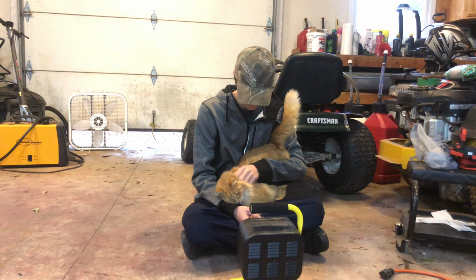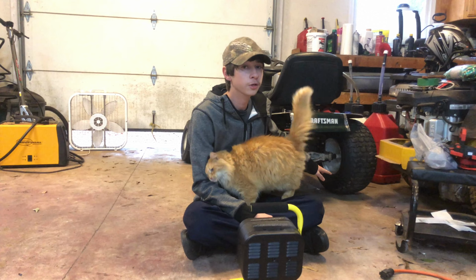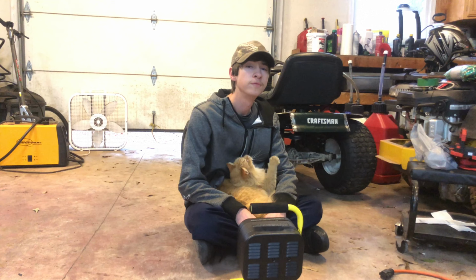So I did the math, and turning 4,000 RPMs, because that's a 1 to 2.5 ratio to the rear end, it's going 53 miles an hour in sixth gear. Cars and Cameras went 42 miles an hour. We're gonna do better, and we're gonna go 53 miles an hour.